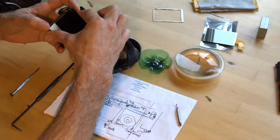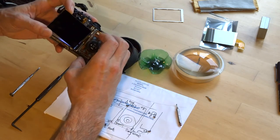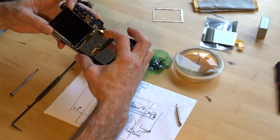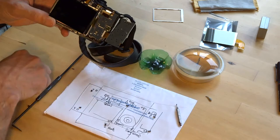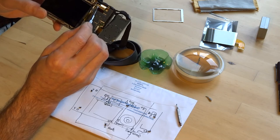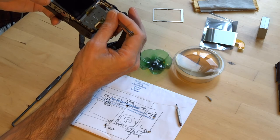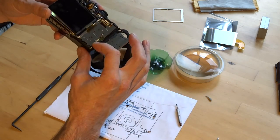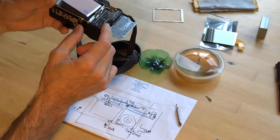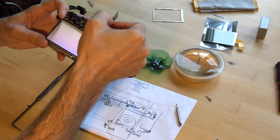Now, to remove this connection, that one is for the panel, comes off, is fairly tough, this small one. This larger one here, you have to lift the small black clamp. It just pops up and you press that down afterwards to secure the cable. Can't quite see what's going on there at the minute. And then, so long as you've released this lower panel properly, there's a screw underneath as well. You can reinsert, having removed the old screen.